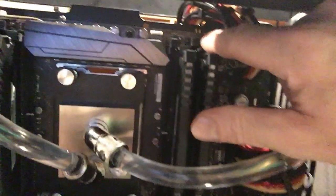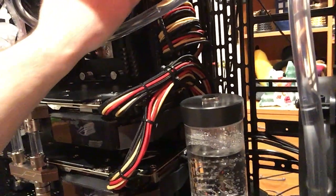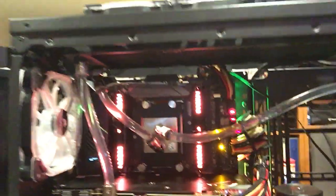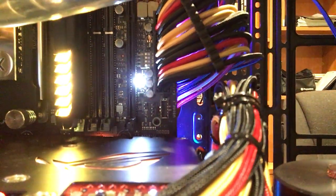Let me remove these two on the end — that one and that one. This one on the end is very tight but that's okay. Now with these out, I turn it on. Usually it always works with two in these two slots. Power it up — memory goes past, no problem. Past memory, we get past the CPU, and now we're booting up.